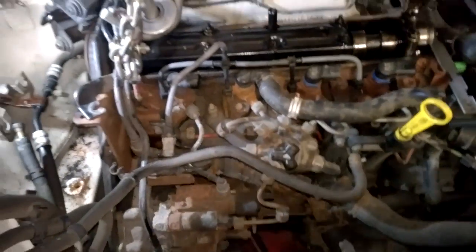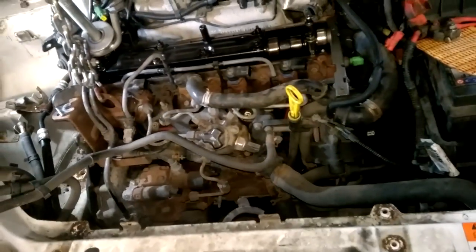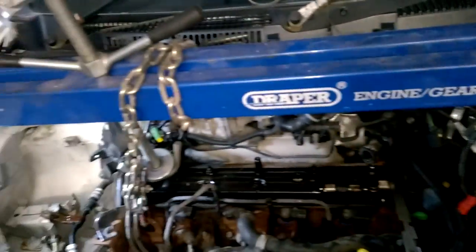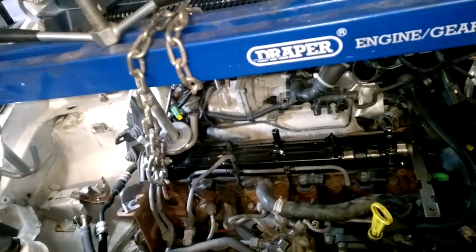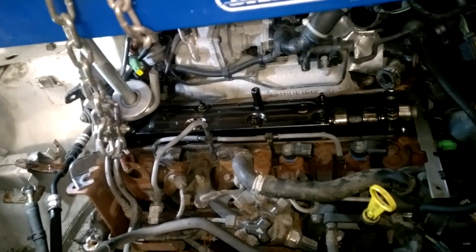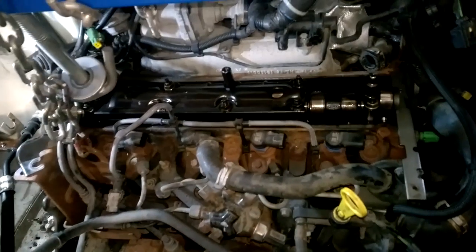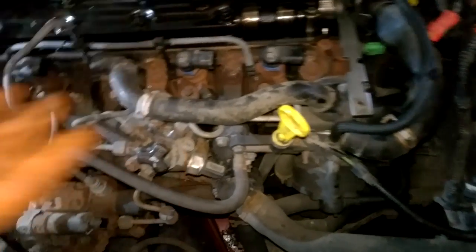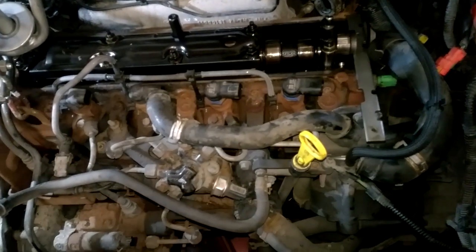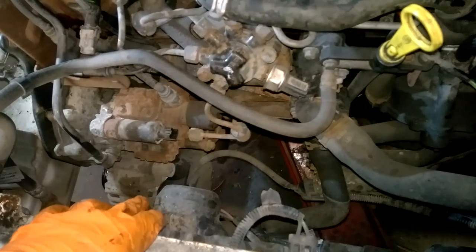At this stage I've propped the engine from the top — I had it propped from the bottom while taking off the engine mount and so on, but now I'm using a gearbox-engine crane support. If you don't have these tools, which a lot of people won't, I'd suggest you remove the starter and whatever other components are underneath first. I have the luxury of having the lift and the crane, so I can strip the top. I'm going to rise it up, remove the starter, I've disconnected the battery, and in this instance I'm taking off the alternator as well.